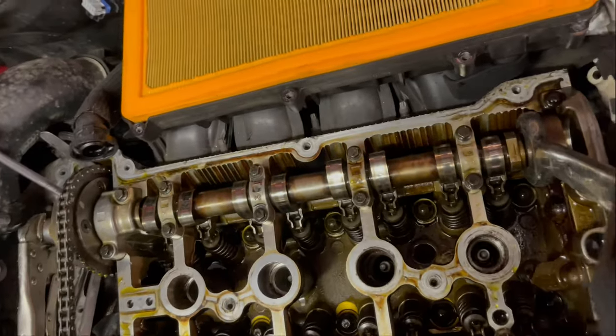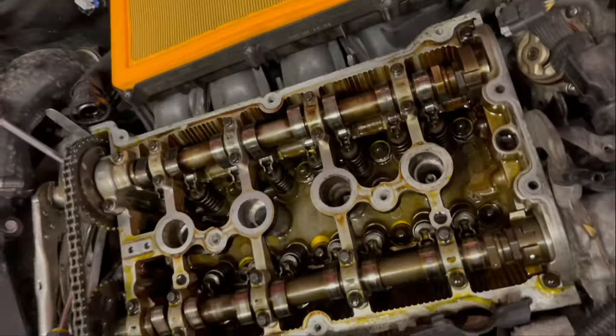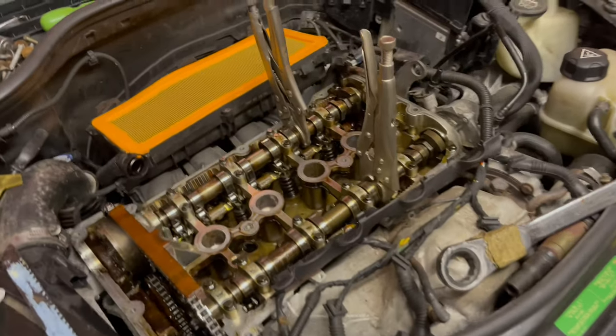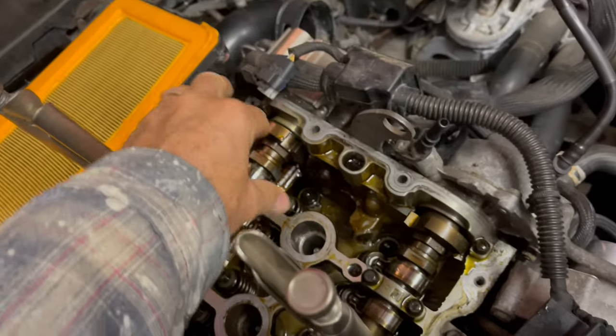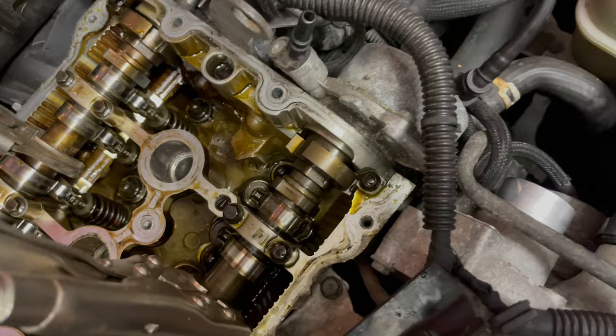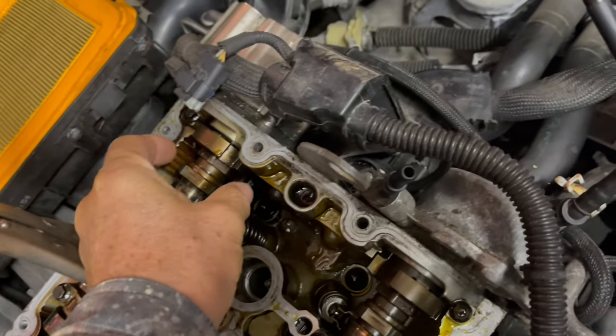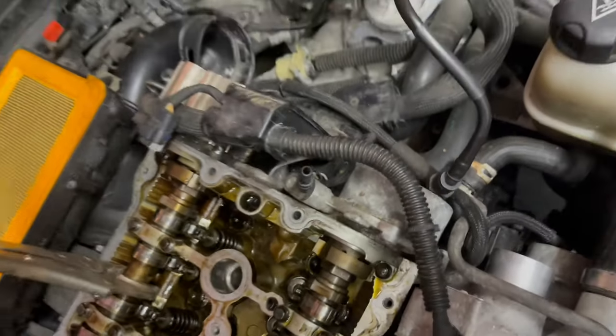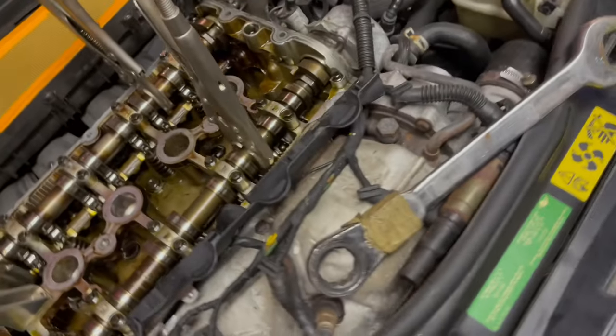Once I've established we're in the safe timing position by checking that this camshaft has the writing uppermost as well — how do we set the timing? We can go out and buy the special tool necessary, which is a whole bunch of metal clamps. They basically go over these flats — there's a square-shaped part of the camshaft on both of them, and a tool fits over the vertical sides of these flats, 90 degrees to the top of the head, on both sides.